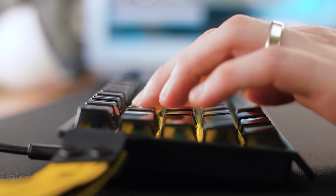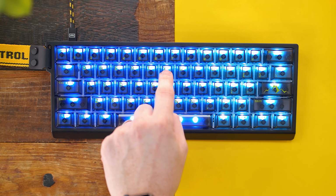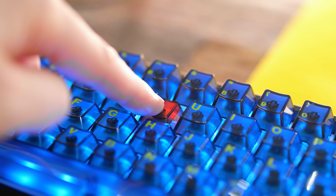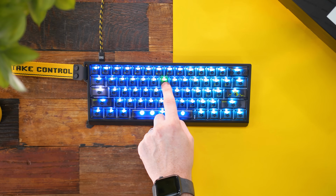And just for visual sake, there is a lighting effect where the green is portraying a press and an actuation, and the red LED shows its reset. So you can literally press down all 4 millimeters, then every 0.1 millimeter reset on the way up, you can actuate it again, allowing you to pull off numerous actions within that 4 millimeter distance. So if you do the math, that's 39 individual strokes capable per key with just that one full bottoming out movement. Mind blowing.